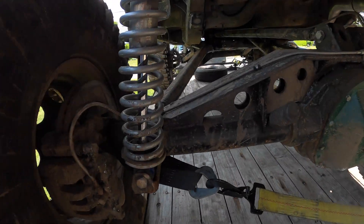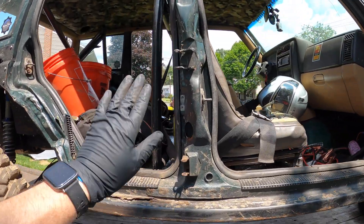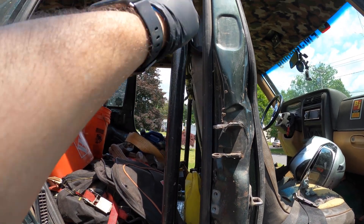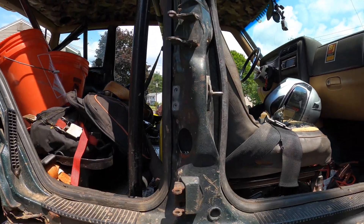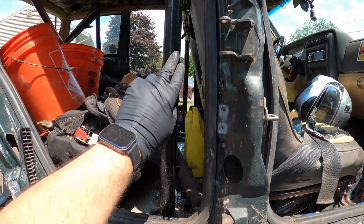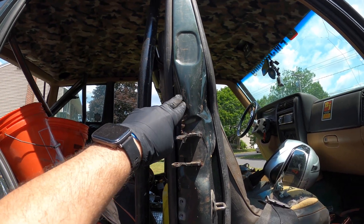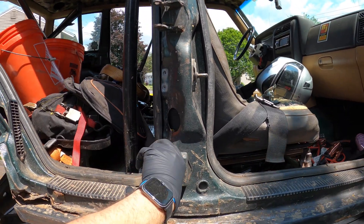There's one more piece of damage I forgot to showcase — take a look at that rear control arm. So now I can finally get the Jeep off the trailer and finish my trailer fenders, and start working on some bigger mods to protect me a little bit more. I'm really considering doing an external B-pillar, bringing the B-pillar down here on the outside. Now that this is all destroyed there's no real reason to keep this, so I'll cut this out, put the B-pillar here, remove the internal B-pillar, and I might even tie into the factory B-pillar with some sheet and dimple dies to add a little bit of strength there.